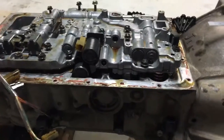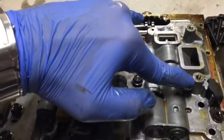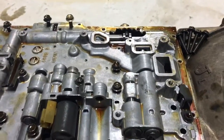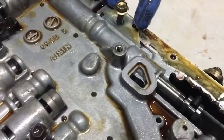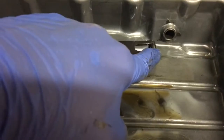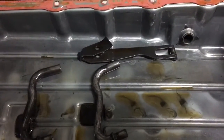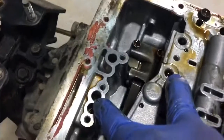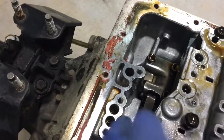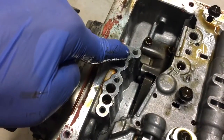The older ones have a cable kickdown. I've just taken the filter off — there's no secret on how the filter goes. It uses these pickup points here: one, two, and three pickup points. I took a heap of pictures of how all of this sat, including the retainer clip. This is where your shift lever internal parts go. Those are your two internal pipes which go into that hole, that hole, that hole, and that hole. That hole there is not utilised — it's this hole connecting to this hole, and this hole connecting to this hole.